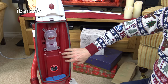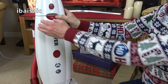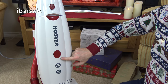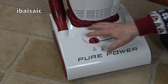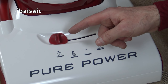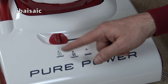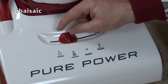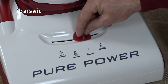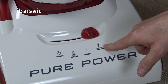You can put the bag door on without the bag in place but I wouldn't recommend it. There's a nice little Hoover logo on this. To conclude the tour: the top of the cleaner head incorporates a four-position height control. Setting one gives the best efficiency for carpet and hard floor cleaning — low pile carpet and general floor cleaning. Setting two is for medium pile carpets and more delicate flooring such as vinyl. Setting three is for medium to long pile, and setting four for very long pile or shag carpeting — it's also the position you use when using the onboard tools.